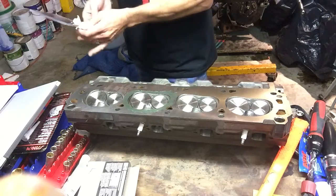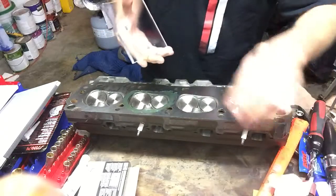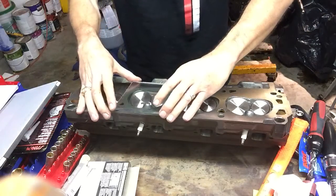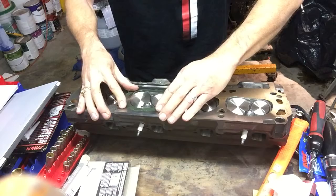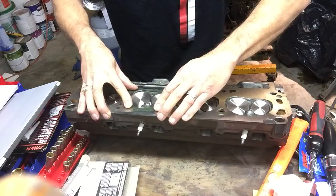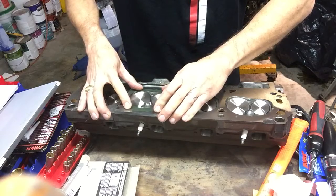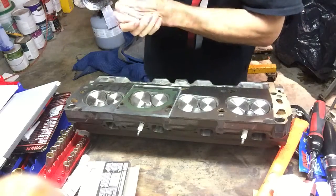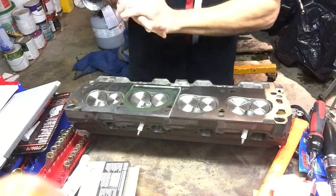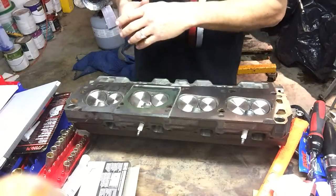Like I said, it's just plexiglass, but you'll note that there's a hole in it. It's a hole here at the top, and that hole is going to go toward the top of our chamber. You'll notice I've got the head at a slight angle. I'm going to go ahead and compress it on here, and you can generally see if you have a good seal or not. By the way, the grease smears here. So now we basically have a sealed combustion chamber, a little bit of grease acting as a sealant. We've got the hole at the top of the combustion chamber, and whether you can tell on video, this thing has a slight slant backwards, so that this is the highest point in the combustion chamber.